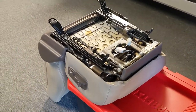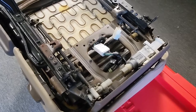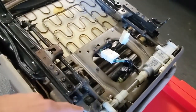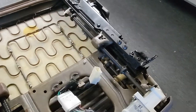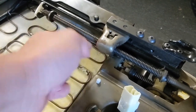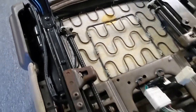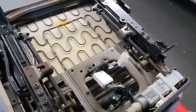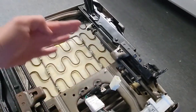Now that we've got our seat out of the truck, I brought it into the garage to work on it more easily. For the forward and backward motion — which is what generally stops working on these seats — there's a motor right here. Inside there's a rod attached at both ends to these long threaded rods. Those attach to a bracket on the seat that has teeth that grab the threads, same on this side, with a stopper on the end. When this main rod turns, there's a gear here and a gear here that turn those threaded rods, which push against the teeth on the brackets and move the seat backward and forward.